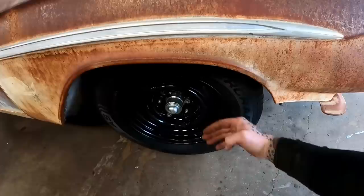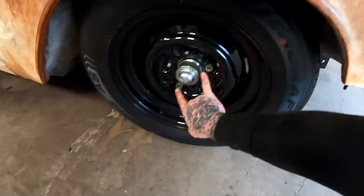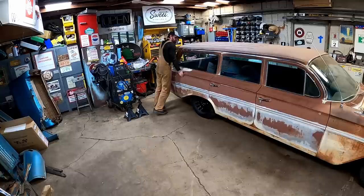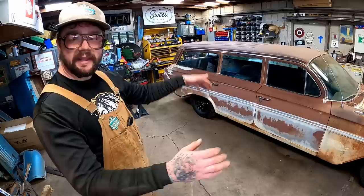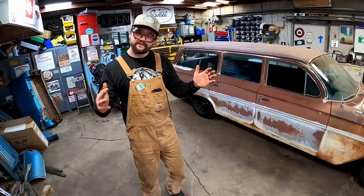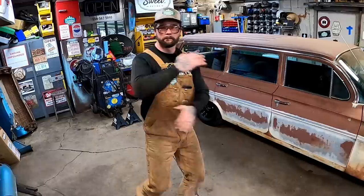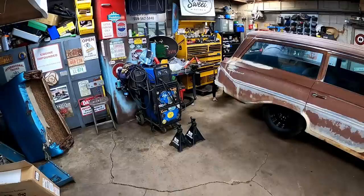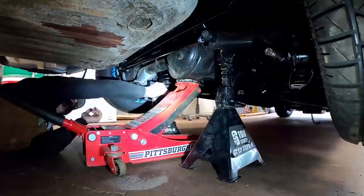I was looking at that - I may have forgotten to tighten those up. Two will do. Now here at the back, obviously with her doing the long dangle back here, we need to put some shocks on. If we don't, we may bounce them springs clean out of there. Now that it's lowered and we know we're going to sit about right in here, we can check side to side of our rear end with the panhard bar and adjust it. Then it should only be tightening up the suspension bolts as far as the hardware. This thing keeps bouncing - I'm gonna get some hydraulics for it.